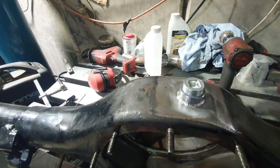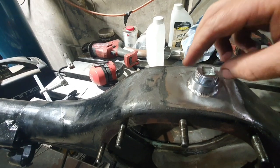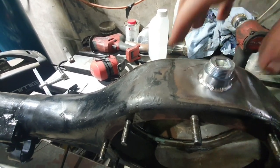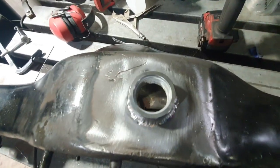It hangs a little low. If this was a four-wheel drive that'd bother me — I could have recessed it and stuck it up in there a little bit. Being a two-wheel drive, I think it's going to be totally fine. It's going to make it a bit of a bugger to jack off, and I thought about putting something around there so I still had a good jacking perch, but for the few times we're going to jack this point, it's not going to be that big a deal. And we can drain oil really, really fast.